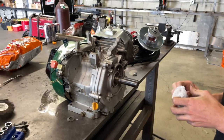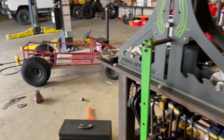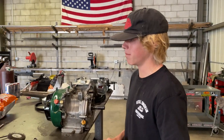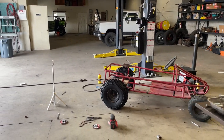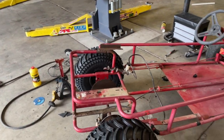Oh yeah. Especially with those big tires, I just don't think that clutch would have a good time. I think those, what are those, 23s? Yeah, like 22s, 23s. There's just no way I'd be able to push it. Yeah, there's no way. We'd probably burn the clutch up. The sprocket's not that big compared to the wheels, so we're probably gonna have some pretty good gearing for a torque converter, but horrible for a clutch.